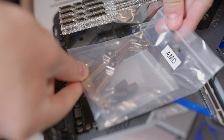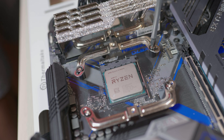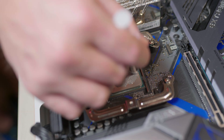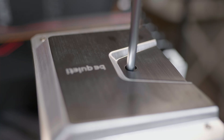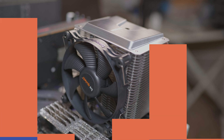Grab a Phillips head and your specific mounting bracket, add mount spacers, screw on the metal brackets, apply thermal paste, gently set the cooler to the CPU, screw the mounting bar to the metal brackets, and insert the Phillips head into the top hole to reach the under screw.